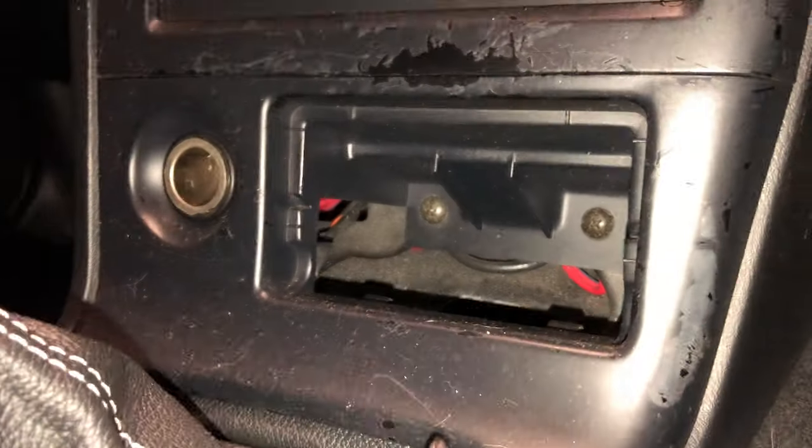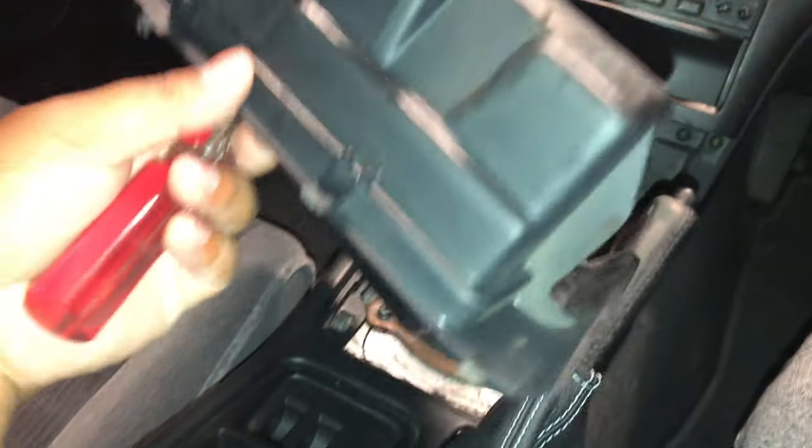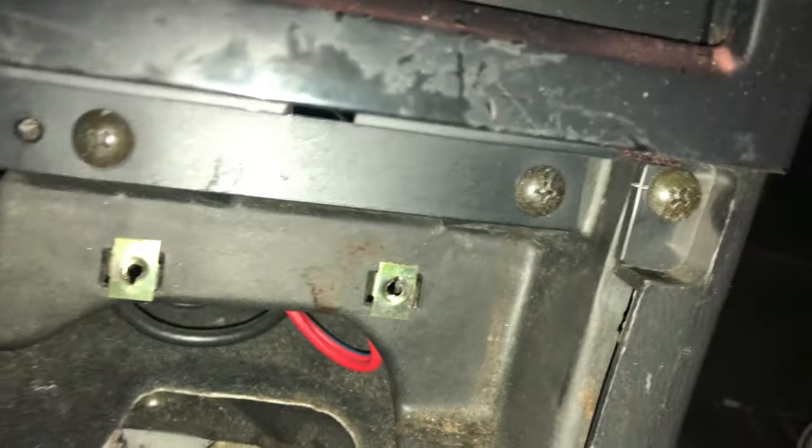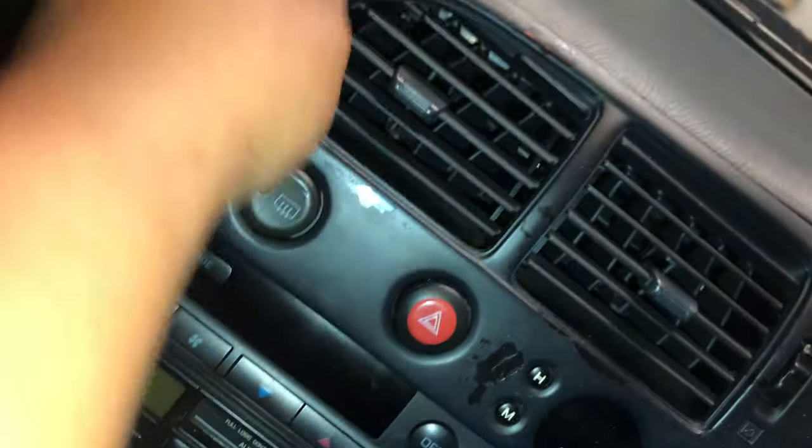Firstly, if you don't have a cigarette box thing — back here, let me turn on the light — there's these two screws you wanna unscrew and this bottom half should come off with a little bit of wiggle, and that should be it. So once you get the boot off, the cigarette lighter connectors are gonna be right there. It's gonna be these bolts right here that you wanna take off, and this thing should come off with another bolt somewhere over here. Once you're done taking these bolts off, you just wanna go around the edge and wiggle it off. Be careful cause there's still wires behind here. If you have a plastic pry tool, go ahead and push those out with that — that's a lot safer so you don't damage your dash.